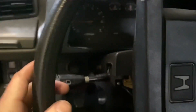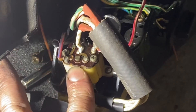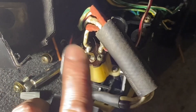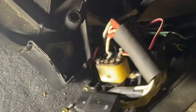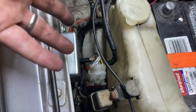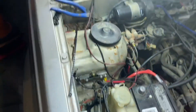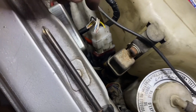Headlights engaged — that didn't fix anything. So this whole thing went off the rails. The steering column is taken apart, and I brought the headlight switch apart. When I dropped this out I did take the relay apart — there are two screws, you can pop it off, and there are literally four sets of points in there: two for the turn signal and two for the headlights. I cleaned all those up, but I don't really think that helped. I did all of the by-the-book regulator pin testing for the alternator and the regulator — it passed — but I swapped it out anyway with a mechanical one that matches OE instead of solid state. That seemed to actually make matters worse, so it's not the regulator and it's not the alternator.